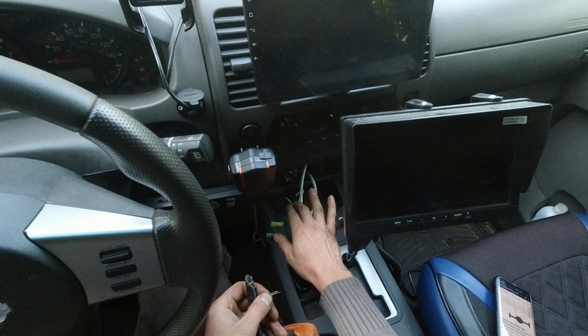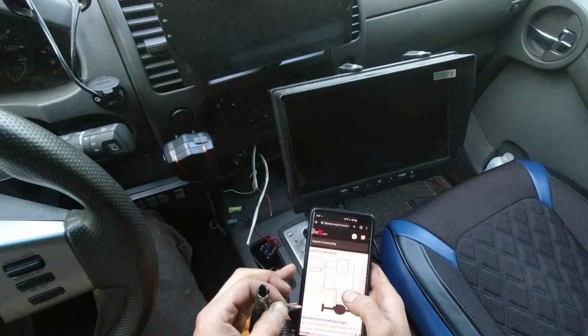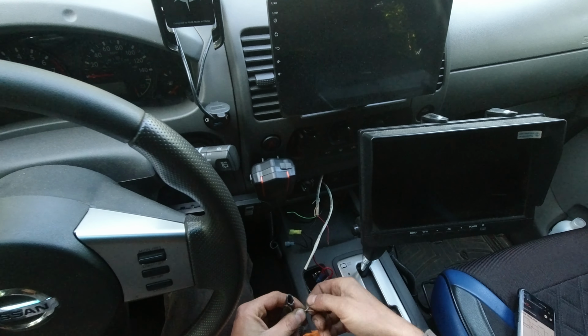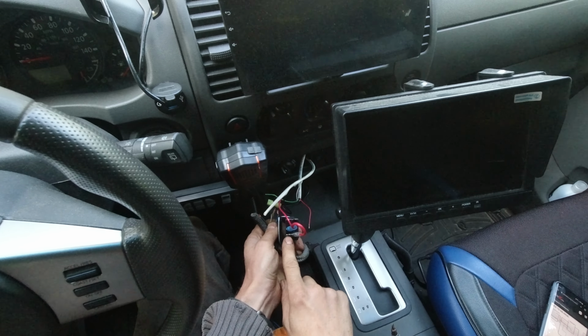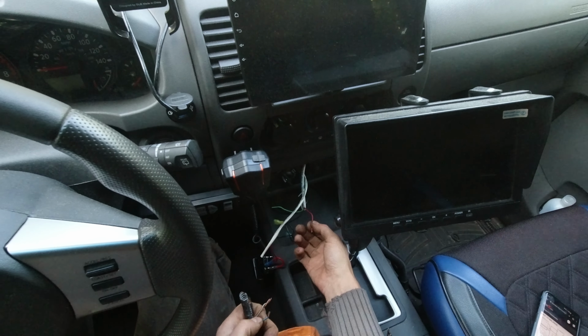So it's gonna come on a green wire, and all we need to do is take these two wires, according to the diagram, to our negative bus on the fuse box. So that's gonna go to the negative, these two together, the gray and the brown. The blue cable is gonna go to terminal 3 of the switch. Simple as that. So that's gonna come on my red wire.